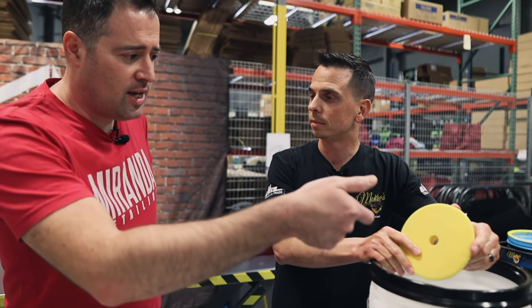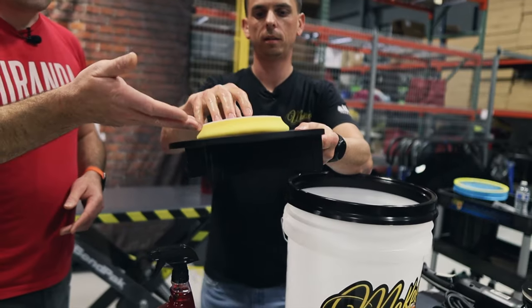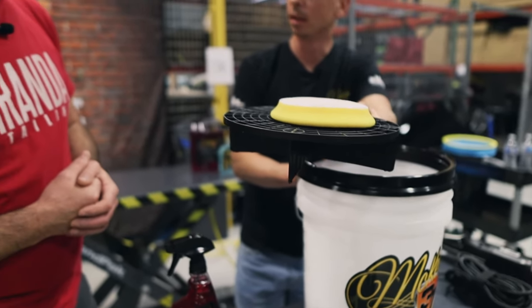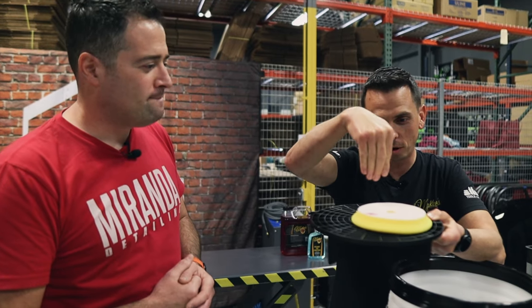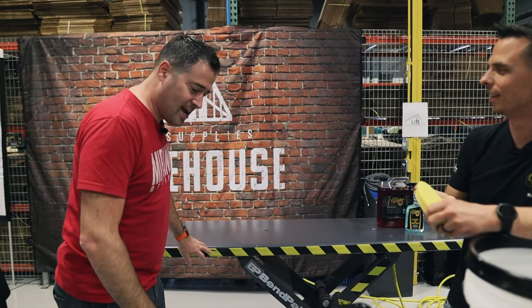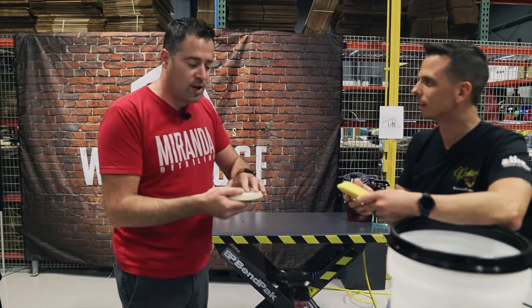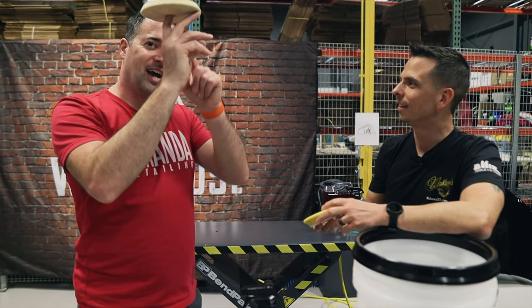Make sure your pads are clean at the end of the day. For drying: you can put the pad on your polisher, run it on high speed to spin out moisture into a bucket, then put it on a towel or on a rack. A baker's rack is really good if you have room. Some guys put them on an old box fan. When you dry your pads, let them dry face down — that way the moisture drains down and doesn't sit in the backing material. It'll make your pads last a lot longer. There are even creative setups where people Velcro all their pads inside a van roof so they dry out over time.